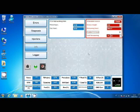To let the owner of the vehicle be aware of this with a forewarning, we've added this parameter, lock forewarning. By default it is set to 30 hours, so in this case we've put 300 hours as a scheduled service. When we get to 30 hours before expiring, so when the ECU counts about 270 hours of gas driving, the switch will beep at every vehicle start, allowing the customer to switch to gas and go to the workshop. Once the 30 hours are expired too, the switch will beep again at every vehicle start, but the ECU will not switch to gas anymore, unless the installer in the workshop makes a reset of the scheduled service.